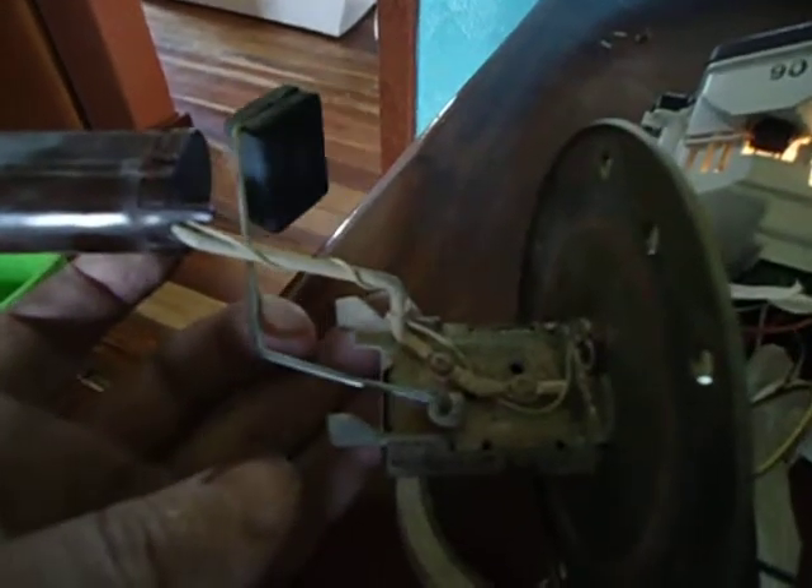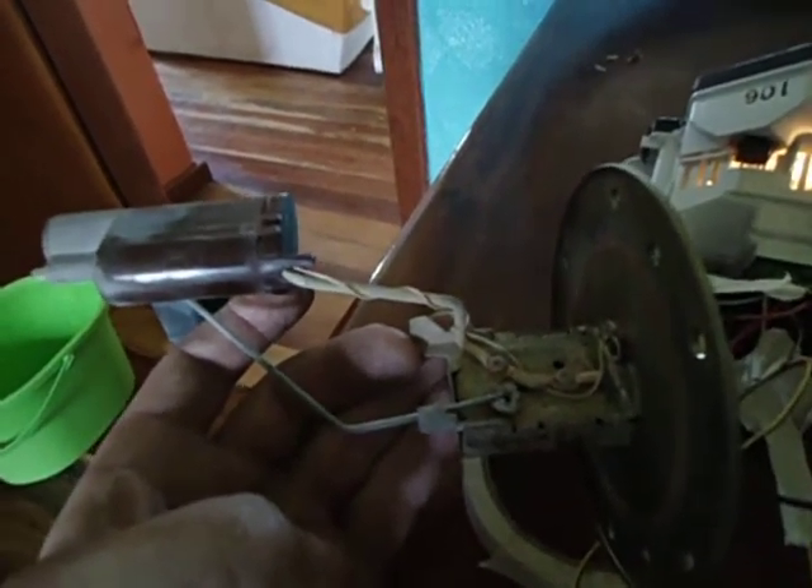If we decrease the resistance, the fuel level must go down into an empty state. This is the Honda S2000 AP2 cluster. I'm retrofitting the signals in order to make it work properly on my Mitsubishi Eclipse. As you can see, the fuel level is all the way down — it means there is no petrol in the tank. If I put it up again it escalates back to the top. So that's done.